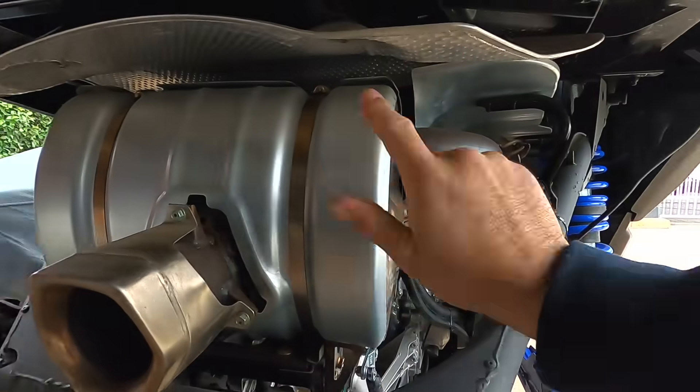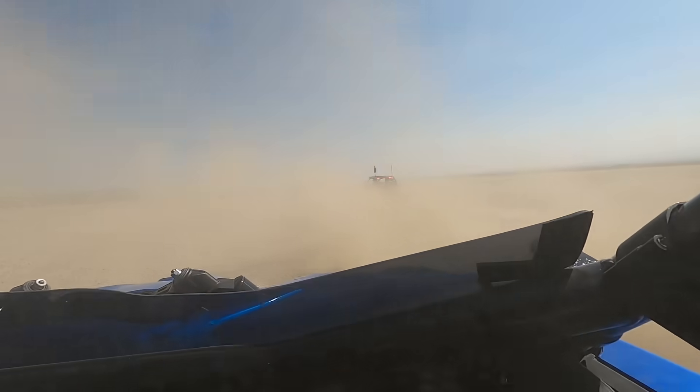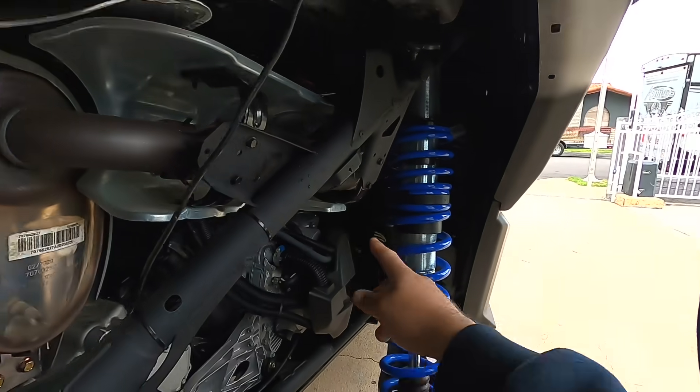Personally I think it's really cool because if you want to ride with the family you can run the exhaust through the muffler, and then when you're tired of that and you want to go race your pals and flex on them, you hit the Shocker and it dumps out right about here. First we're going to start with the passenger side seats to access the center tunnel to run the wiring for the switch, then we'll come back and take off the muffler followed by the cat.